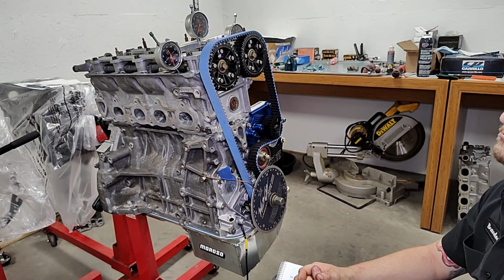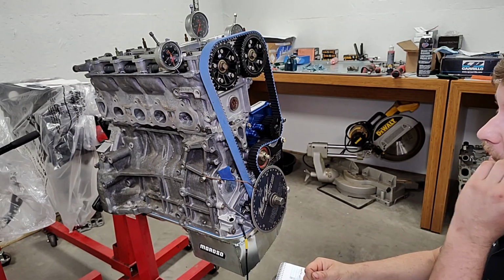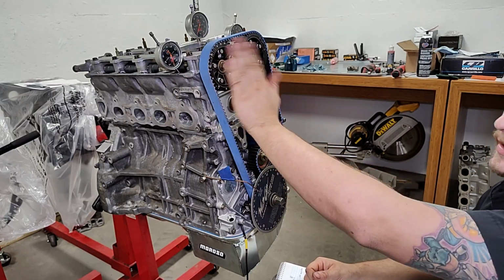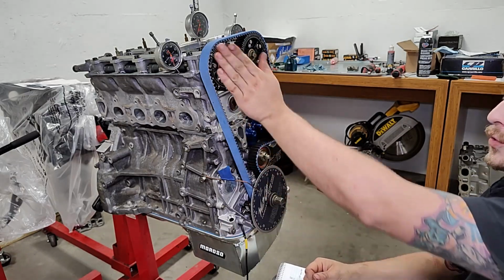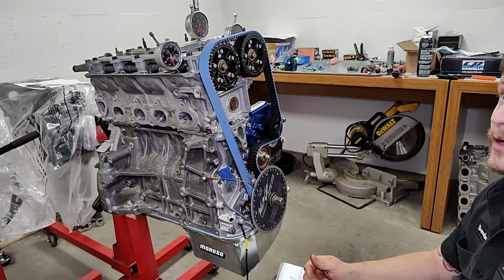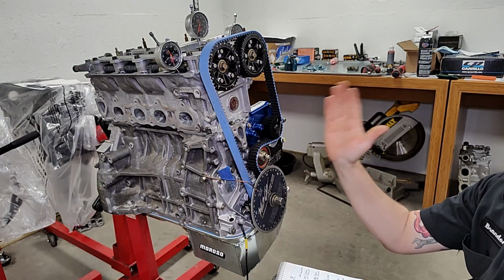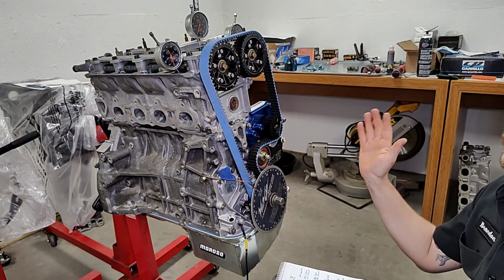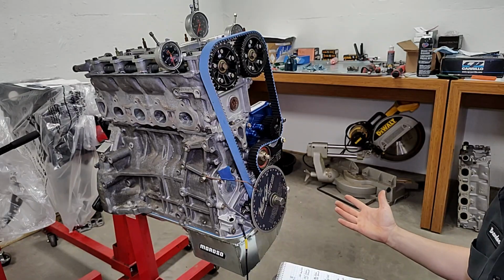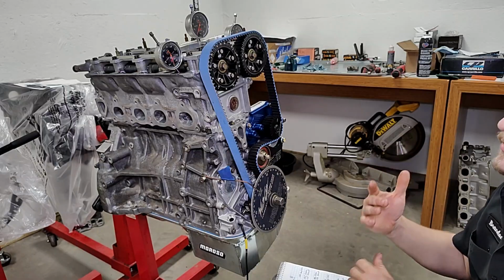And I mean, even a daily driver car that someone brings me, if it's got aftermarket cams, they get degreed. Like I was telling you earlier, when we were moving Nathan's exhaust cam 1 degree at a time, in 40 pounds of boost we were picking up 50 horsepower per degree we were moving it. It's a lot. And when we got to a degree that it only made like 2 more power, we went back 1. Then we reconfirmed with my chart, and where we moved it back to was where we started. So it was degreed properly.